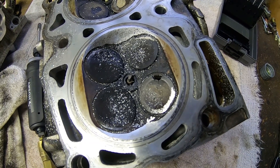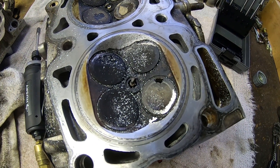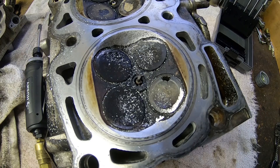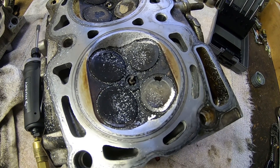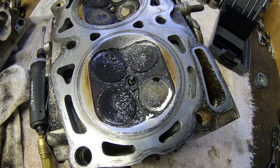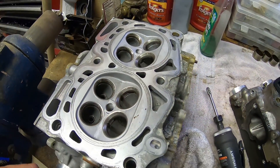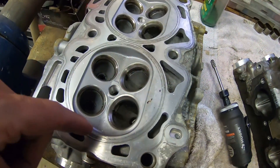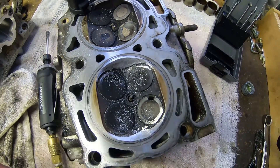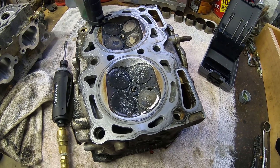I'm just opening these up a little bit. They're not going to be exactly the same each one, but they're going to be really close because the shape of this part of the cylinder head kind of dictates what you can and can't do in terms of taking material out. Using the head gasket as my guide and this other cylinder head as reference — right now you can see this one goes straight down whereas this one I have it kind of cupped in.